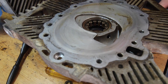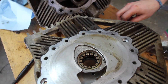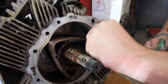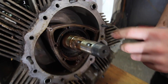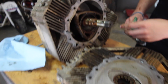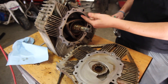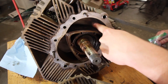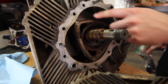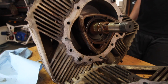It's got some marks — I guess it was sitting right there. But this is way clearer than expected. This is what I was concerned about when cranking it over. I think we just clean all this off because it's hard buildup. When this gets dislodged, especially after sitting, the gas residue becomes little pebbles and when they get scraped up against here, that's when we score the inside. Time to spend a couple hours cleaning.